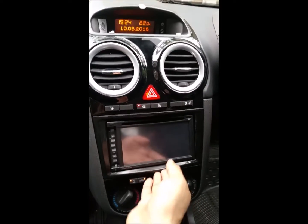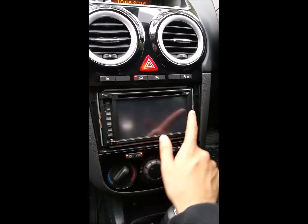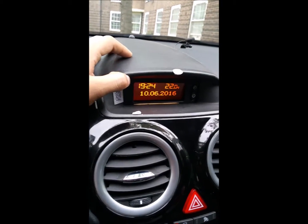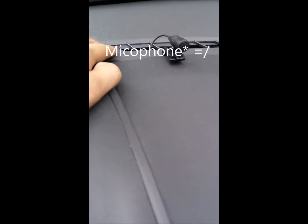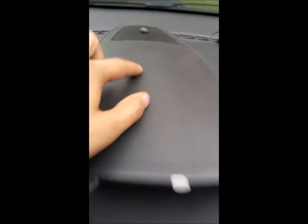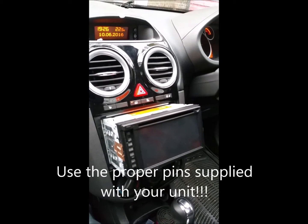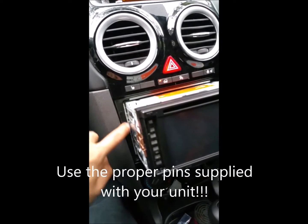So the head unit largely just comes out like this. I just unclipped that so it doesn't make a massive noise. You've got two pins there you would undo. And then underneath this part here I've actually hidden or concealed the sat nav and the wiring loom for that headphone jack, so that goes all the way through. It comes out at the bottom here where I've tucked it in via that route and through this column, drops through the middle and then plugs into the back of the head unit. Here I've just loosened the head unit and it's slid out of the cage, and you can see the room in the cage that I've installed.